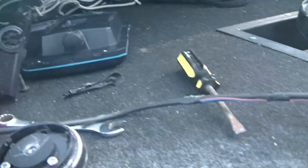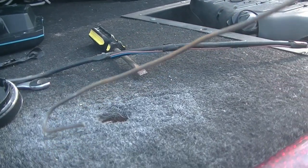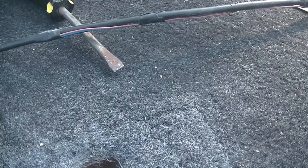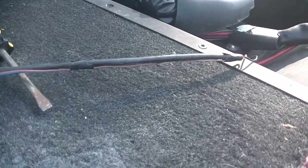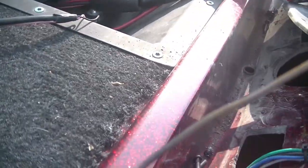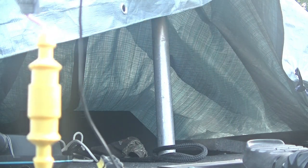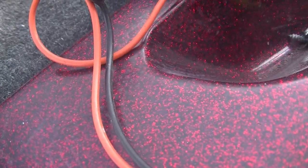So you remember our wire we used to fish the transducers through - I'm going to do that on a smaller scale here. I have some 14-gauge annealed wire with a hook in it, because an 8-year-old girl couldn't reach her arm in there far enough to get this wire through this hole and back for power. I'm going to put some bends in it to reach in and hook the wires and gently pull them up. I'll put a little tape on my power and ground wires and the fuse and push them through that hole.